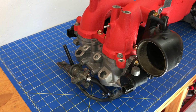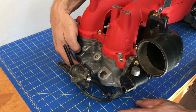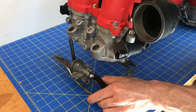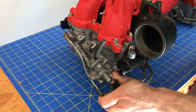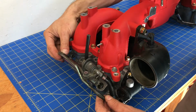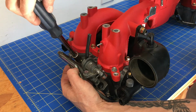Okay, once you're able to get those fuel lines through that gap on the left side, you can go ahead and move over to the fuel rail on your right side. Now this one might also seem kind of complicated, but if you walk through the right steps, it's actually not that difficult. We just got to get this fuel rail so it can bolt down to these two holes right here. To do that, lift your fuel rail up, and then pull that fuel line and fuel rail assembly over to the front of the intake manifold, and then just slip it around up and over those little ports for your fuel injectors. And you should be able to slip this thing over and line it up with those holes so you can put a bolt in there and hold it in place. Just like that. And I'll grab one of those new zinc plated bolts and I'll loosely install it to hold everything in place.